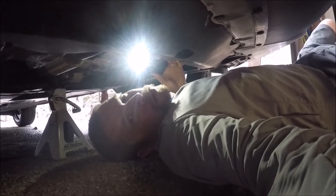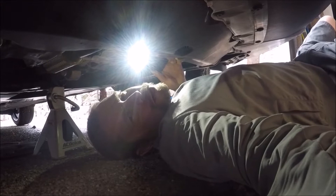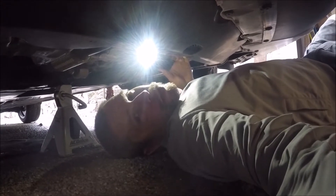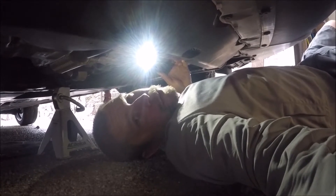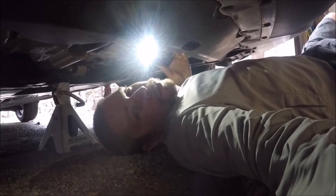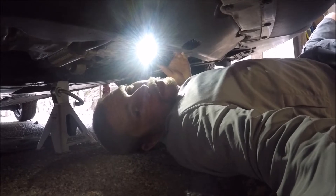With the cap being on the overflow that's constantly under pressure, I'm wondering if this new system is more like my BMW than my old Honda — where if I put it in that reservoir it's actually the same as adding it to the radiator. I'm going to look into that. Chalk one up in the idiot column for me: I didn't need to pull anything apart. The fact that the cap is on that surge tank — not overflow, surge tank — and the line runs right into the radiator means the coolant in there is constantly in the system.